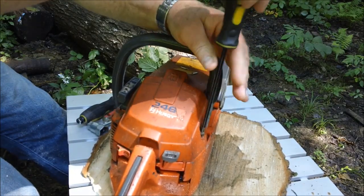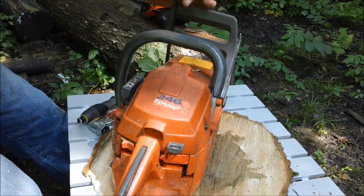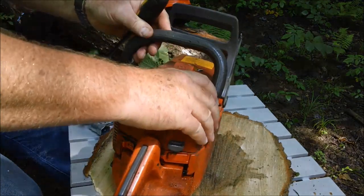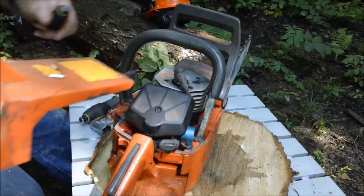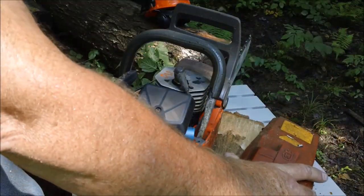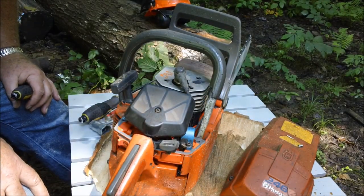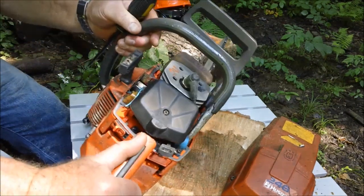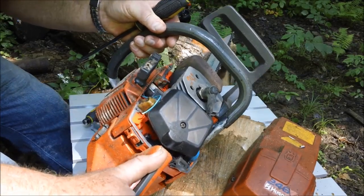Now, this series of saw, I happen to like these. I've got a ripping 238, which acts like a 50cc saw. You know, it looks complete. It says it has a 242 top end. It is hot. Hot, hot, hot. Of course, the other thing it could have is an air leak. Very easily could have an air leak.